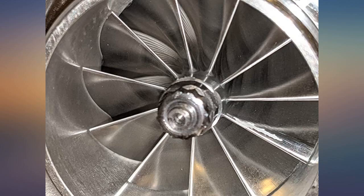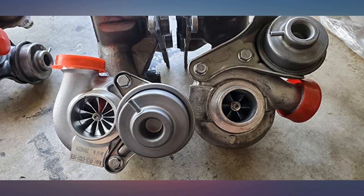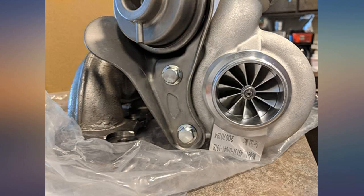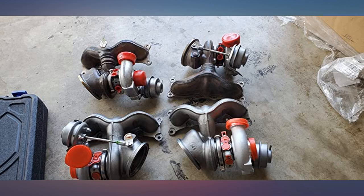The turbo clamp had to be adjusted in order for me to install the coolant lines. The wastegates did need to be adjusted as well. These turbo wastegates should be fully closed at 6 to 6.5 inches of mercury. The rear turbo was closing at 7.5 inches of mercury while the front was closing at 5 inches of mercury. This could cause one turbo to overwork overall.